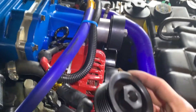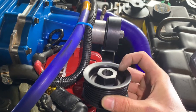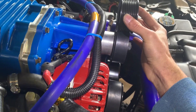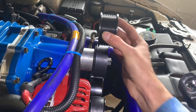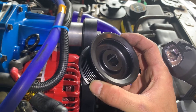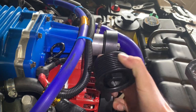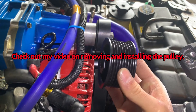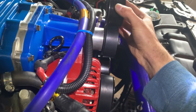This pulley here is the eight-rib pulley that I got from Pulley Boys - that's in the description. I'm essentially placing it on top and lining it up with the old one to get a feel for what to expect. It has a greater offset on one side than the other, so I have to take that into account. The original six-rib pulley has the larger offset toward the back, so most likely that's what I'll have to do with the eight-rib - install it with this side facing the supercharger.